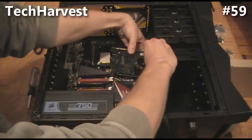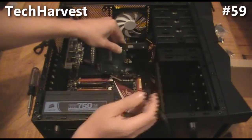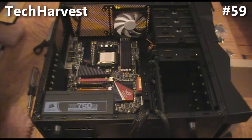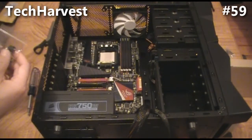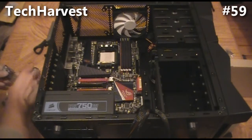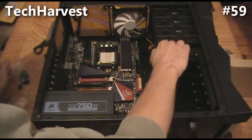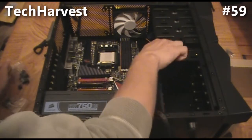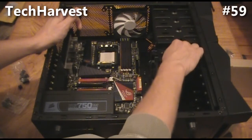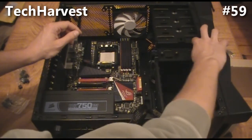Try not to bump your motherboard. Take your drive with the cords pointing backwards and just slide it into the top slot — all your screw holes should match up. In this case we have thumb screws, which make things easier. You can still screw them down without any tools. There are actually six points where you can screw it down. You could use a Phillips screwdriver, but let's see if thumb screws keep it nice and tight.